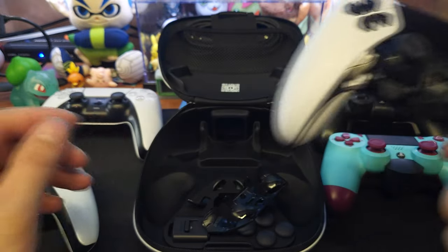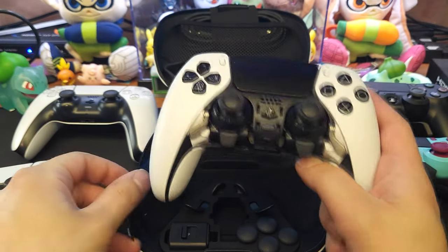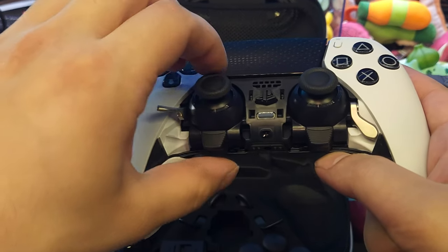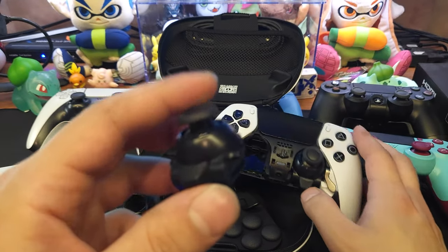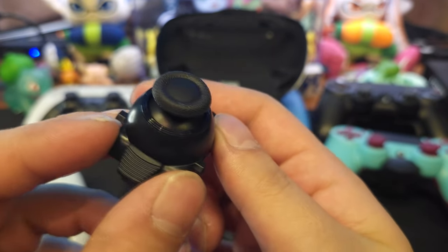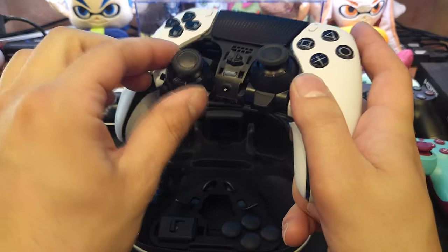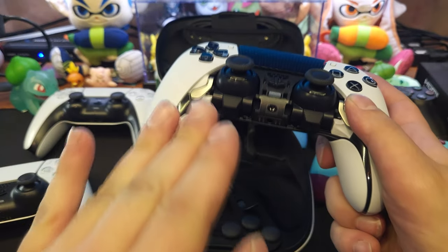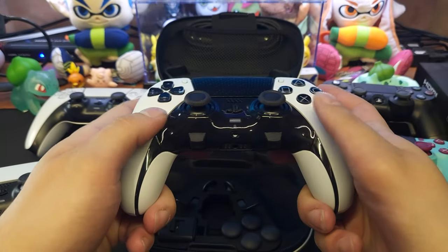Wow, that's a lot easier than I thought it would be! Okay, so that releases your cover, and then you just pull up on these — boom — and it slides right out. Look at that, that is so trippy. I'm now holding the analog stick component. These sell for I think $25 in Canada — not a bad deal to get a new analog stick. As you saw, it's so easy to just grab a new one, push it in, and this lever will actually push it and hold it in place.